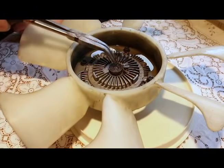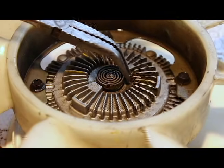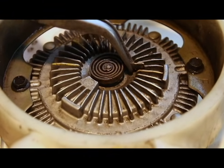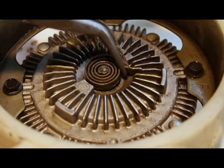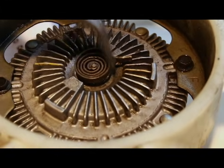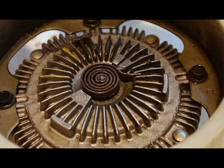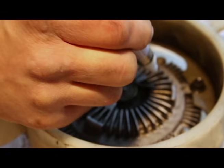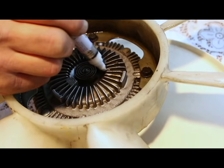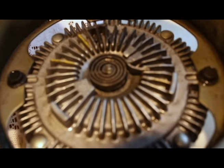My problem was that even though the spring rotated, it wasn't enough — it came on too late, if at all. So the way you fix that — the whole reason why you're watching this video — is to take this spring, see that slot there, and move it over one notch like this. I like to use just one notch at a time. You have to make sure it sits inside the notch so it doesn't come out. One good thing too is if you want to make a reference point, you can take a Sharpie or some type of marker and put a mark so you know where you started. I moved it one notch. If you go any further than that, it'll probably stay on all the time, which is not the situation you want.